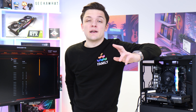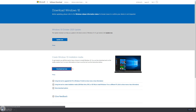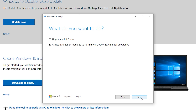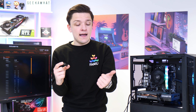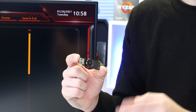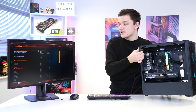We need to plug in a bootable USB — this is the magical tool we're going to use to install Windows. I'll leave a link in the description to the official tool, which you use on an existing Windows desktop or laptop to wipe a spare USB drive and turn it into Windows boot media. Contrary to popular belief, you don't actually need a product key to do any of this — not to create the bootable media, not to install Windows, or even to get gaming. We're going to pop the USB into the rear of our motherboard and boot into that bootable Windows drive.